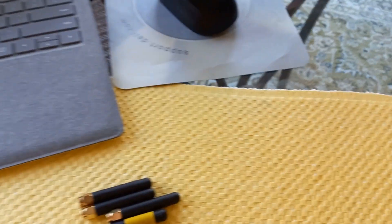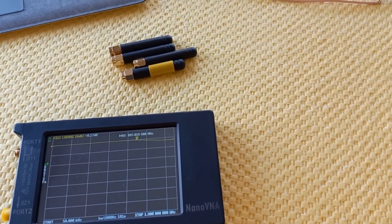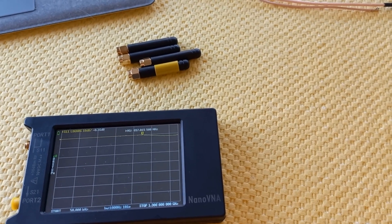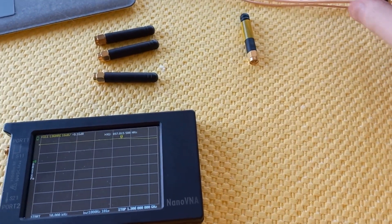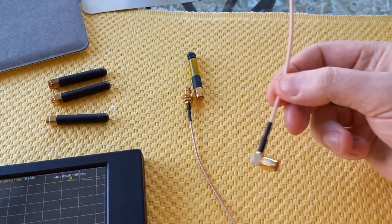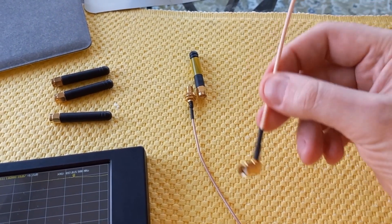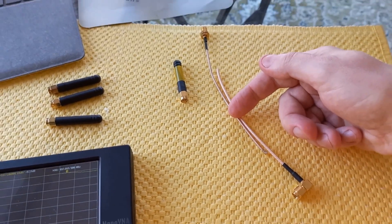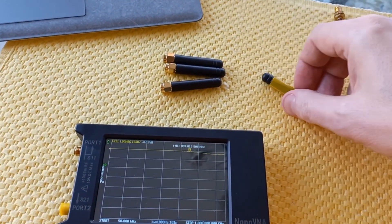I believe it's my antenna — a cellular antenna that I put the T-beam inside the antenna tube. What I'm going to do is go up on the roof, take the radome off, remove the cellular antenna, and just use the T-beam's own antenna, mounted vertically inside the tube. I'm going to use one of these female SMA connectors and a right-angle male SMA because there's not much room inside the tube.